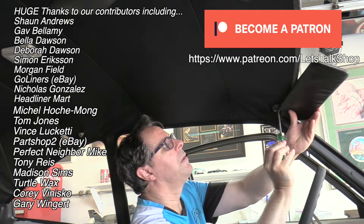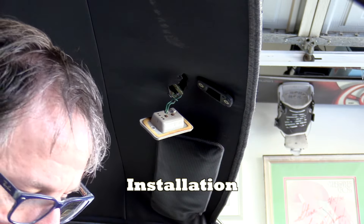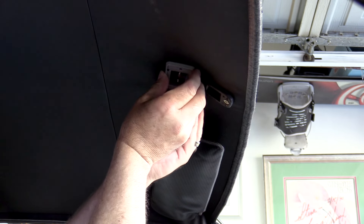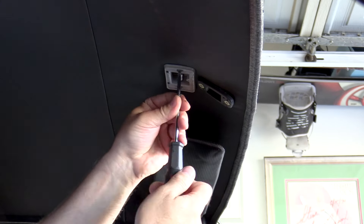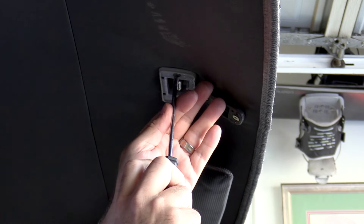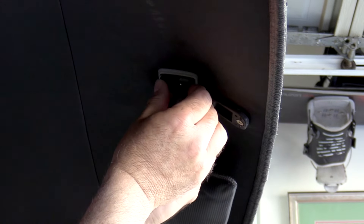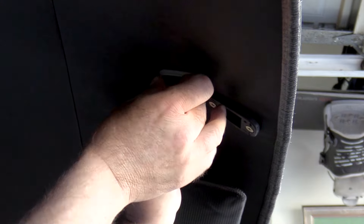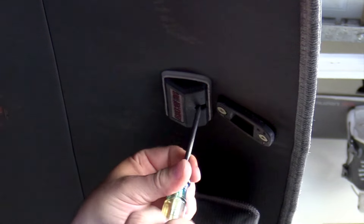The cable just went up the A pillar and off to the dashboard where the buzzer was. I know a lot of you guys' idea of cool mods is to drop a 13B turbo in your RX2 or RX3. For me, a cool mod was making the fastened seatbelt light go on instead of the buzzer, which is really annoying. Click the fastened seatbelt light — lens on — clicks in with a hinge towards the driver, and then there's a screw in the back.